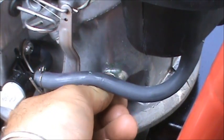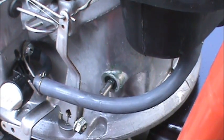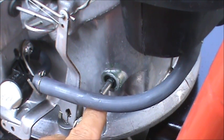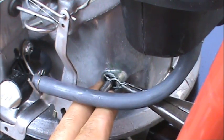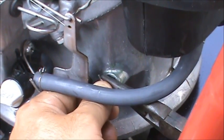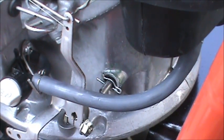I'm going to take my hand and pull the governor shaft completely out — and the seal is still staying in place. That's the way you want to do it. Be careful not to push the governor shaft all the way in and drop it into the engine. Now there's a cotter pin, so we're going to take our cotter pin and reattach it using needle nose pliers. Once that cotter pin's on, it'll prevent the shaft from sliding back into the engine. There is a little keyway that the pin snaps into, so that's locked in place.